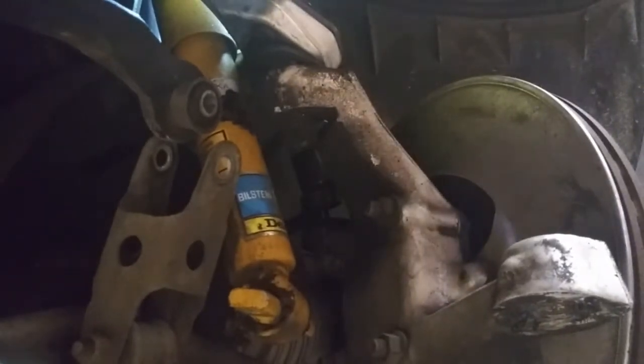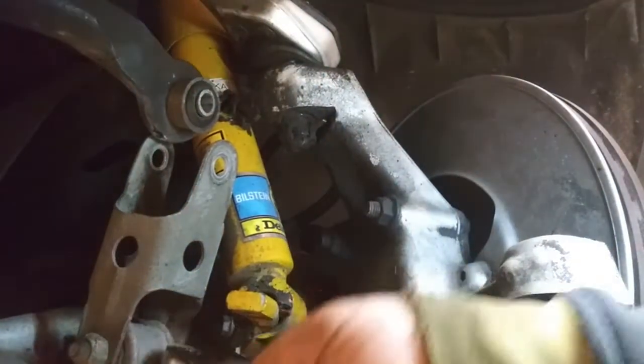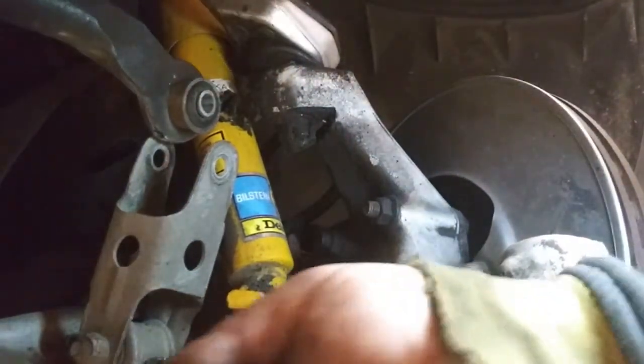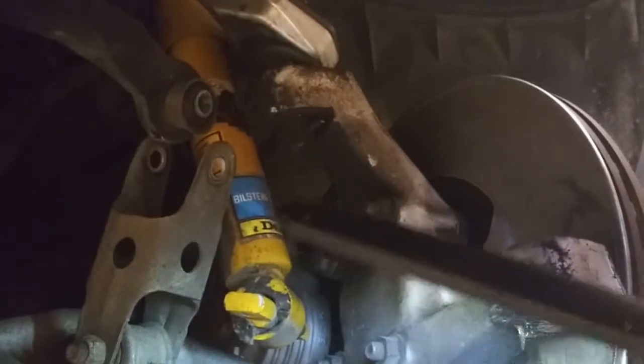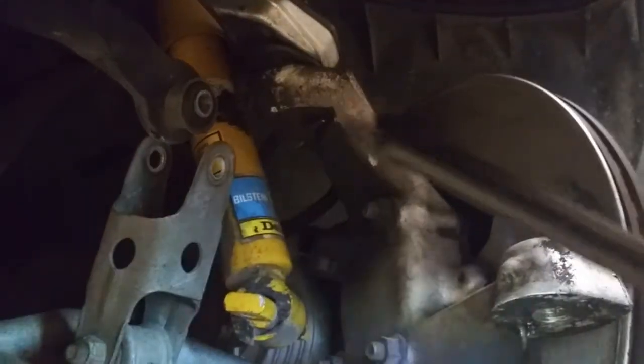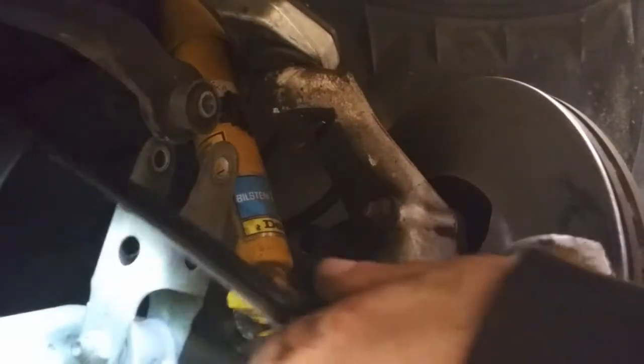Okay, that's not working. I think we're going to leave that - I don't really want to have to pull that all the way off. The next thing is we'll pull the sway bar bracket loose - those two nuts that hold it to the A-arm, that would appear to be 13s. Those bolts go through this metal plate, so you have to take this whole metal plate loose. There's one, two, three bolts.